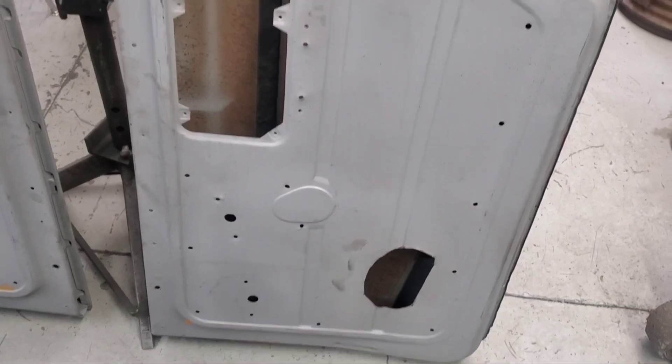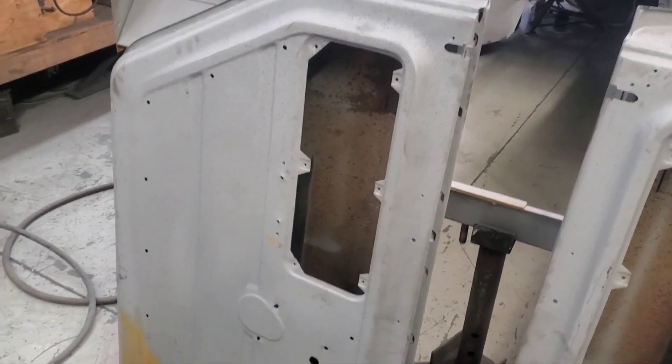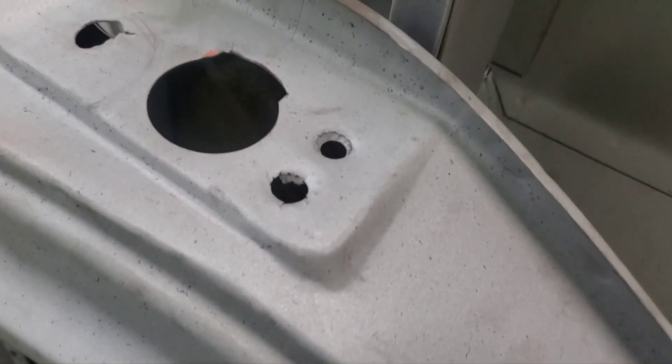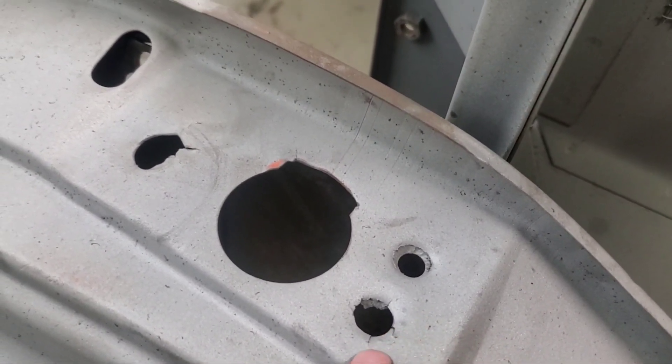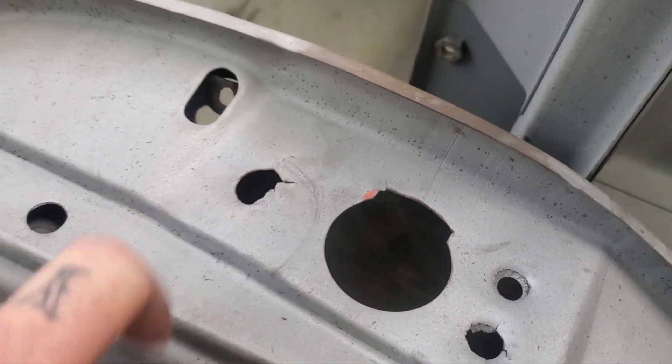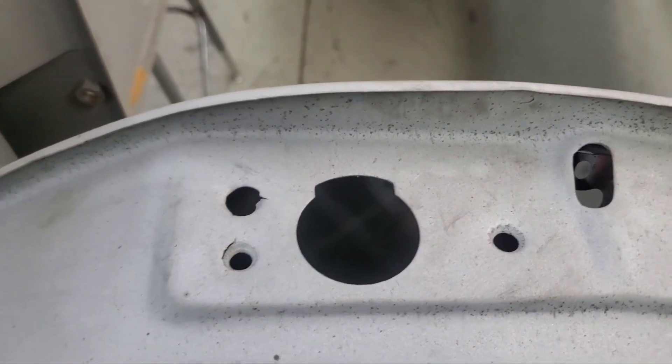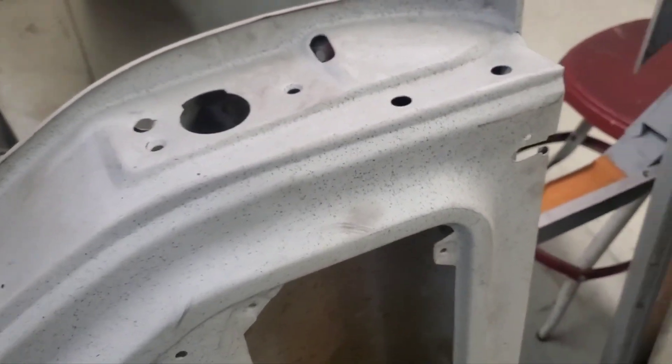One of the upsides to West Coast iron is that we can use our rigs year-round pretty much, and they get a lot of miles put on them. A lot of use means a lot of wear. You can see we've had these doors sandblasted. The door striker — you can see — broken, fully torn out, cracked. Same on this one. Screws are breaking out, fully missing. So we're going to make repair pieces for that.